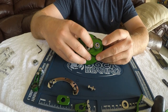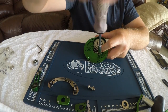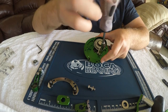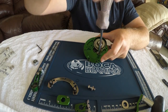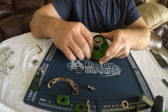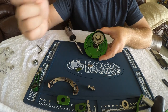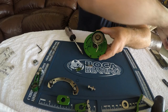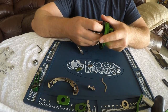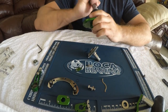Once we have the handle off, you can see one of the bearings right here. I'm going to show you the easiest way to get all the bearings out — we want to take the handle off first. Now we're going to remove the dog. Dog is out. One of the things I see a lot of people struggle with is this S-wire right here. All you want to do is put your finger on it and pull it straight — it comes right out from underneath the C-clip right there. You can just remove it by hand and set it aside.